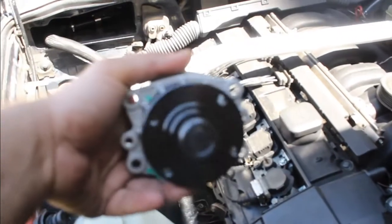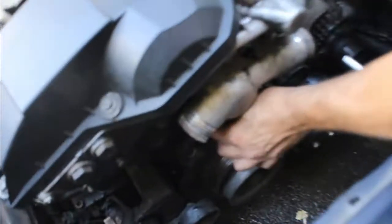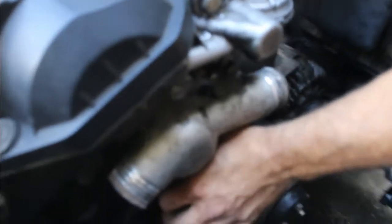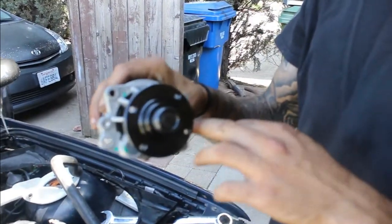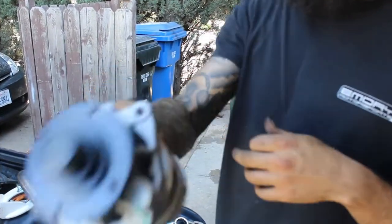Here's the new water pump outside of the car. You need four 10mm bolts to take off the pulley, like we've already done, and four more 10mm bolts that hold it in place. If your water pump ever gets stuck and doesn't want to come out, it's threaded on the sides so you can put a long 10mm through there and press it away from the block. Tech tip of the day.